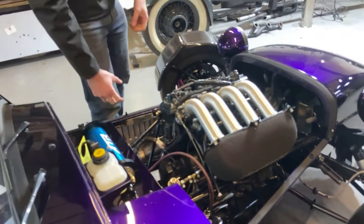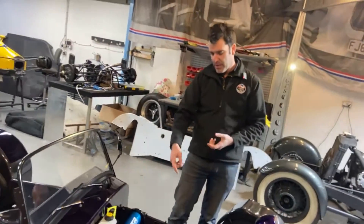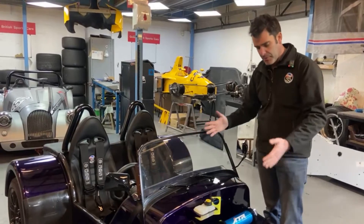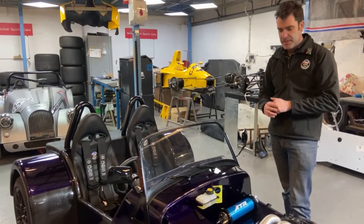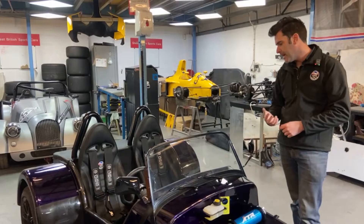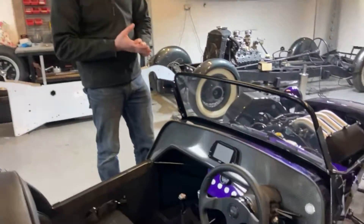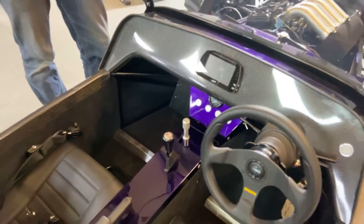All the mounting goes through the engine and you can still take the engine out quite easily. We've then got a prop shaft and transfer box. On this one we've gone with the Quaife gearbox that gives us reverse. The front prop shaft has got a rubber coupling built in — a tube within a tube with a rubber centre — just to take a lot of the shock loads out, which is really important to prolong the life of the gearbox. The Quaife gearbox mount is mounted to the chassis but we've also got an extra fish plate mounting, as we've found in the past you can get some vibration oscillation, so the extra mounting makes a big difference to the refinement.